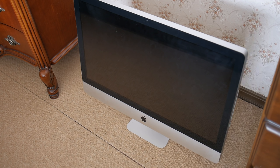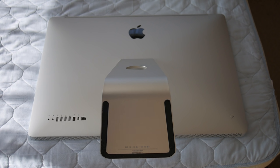Unfortunately, it's now a few years later — about three years after that replacement — and the same sort of thing started happening again, meaning artifacts on the screen. So what we're going to see in this video is how to repair the problem. What we need to do to open everything up is to lay it on a soft surface. In my case the biggest soft surface I had other than the floor is a bed. We have to take out the RAM first because we're going to be disassembling it and taking out the main board.